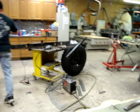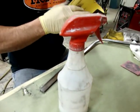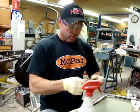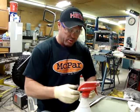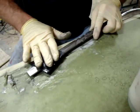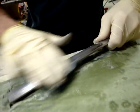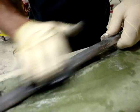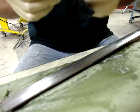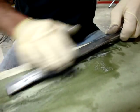The next step is 600 — I need some water, as I like to do the 600 wet. This is a 600 paper; it's a little bigger than what I need. You can get all these papers at any local or auto paint store — they sell them in all different grits and packs. By using a wet 600, it allows the paper to stay cleaner, doesn't clog as much, and carries some of the shavings away easier, so it lasts a little bit longer. I want to work the area over really well at this point, and I've made each sanding area a little wider as I've progressed.